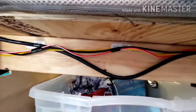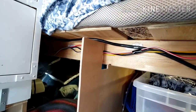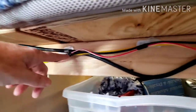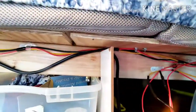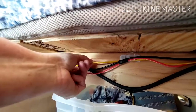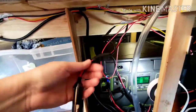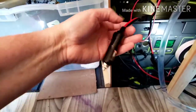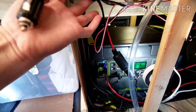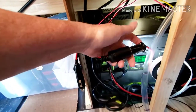The wiring goes through here and it doesn't rub when we sit on the bed. The negative ground wire is really short — it ends right here — but the positive wire has plenty of extra length with a fuse in it, so it would reach the Goal Zero. For the negative we had to buy some extra wire. This yellow wire we connected to the negative. This is a splitter — it's a 12-volt plug with two sockets coming off of it. One has the 12-volt MaxAir fan plugged in.